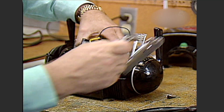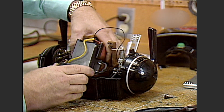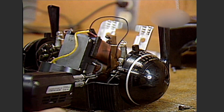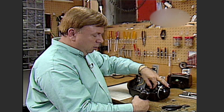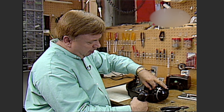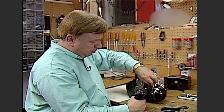The last thing we need to do is unsolder the remnants of the old cord from the coil and the transformer. Let's get this support bracket out of the way so we can get to the wires. If we use something like this roll of tape to brace it up, we can easily see the old power cord and the two points that we need to take the solder off. Use the higher heat setting on your iron — it may take a while because there's a lot of metal to heat up.